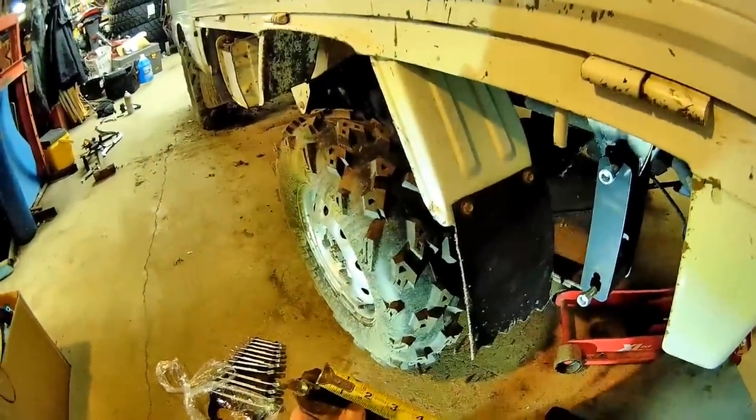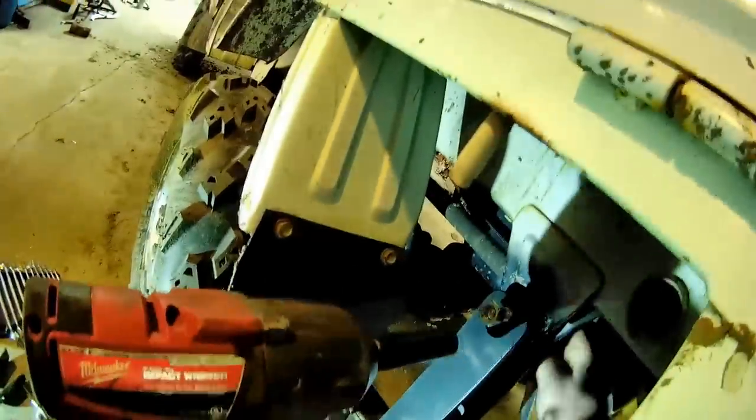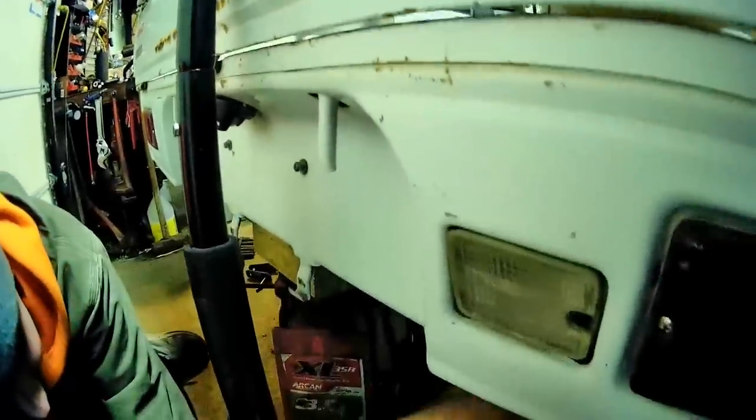If the axle's halfway — which it should be — and this is a two-inch lift, it's got to be four inches longer than stock. This is three and a quarter — yep, four inches, that's two inches of lift. So that's all it is to lift the back: just shackles. It does come out if you pull that little rubber out with it.